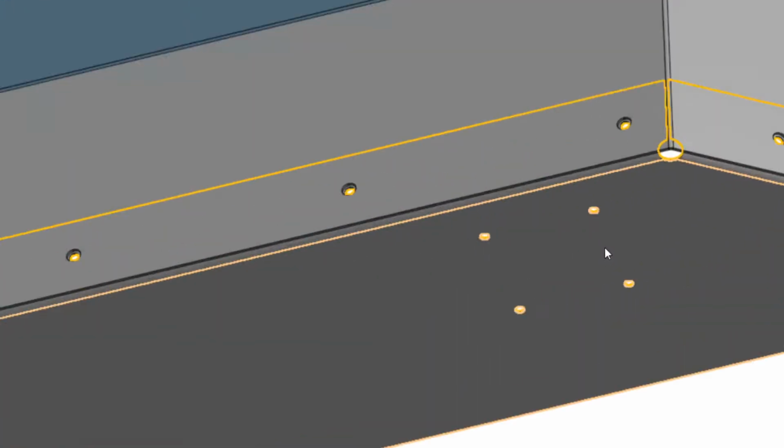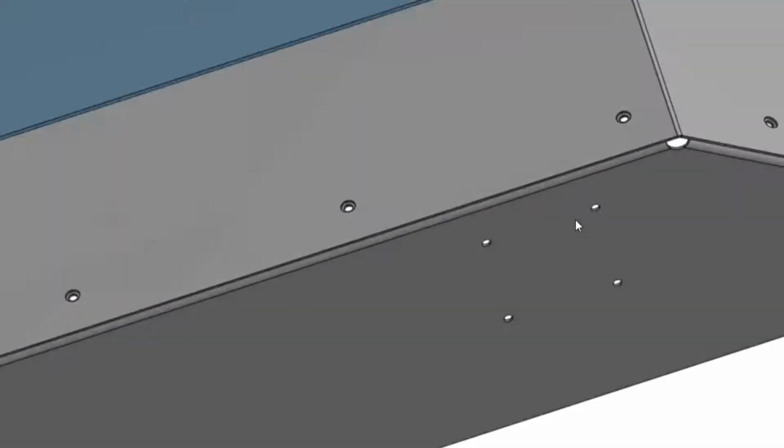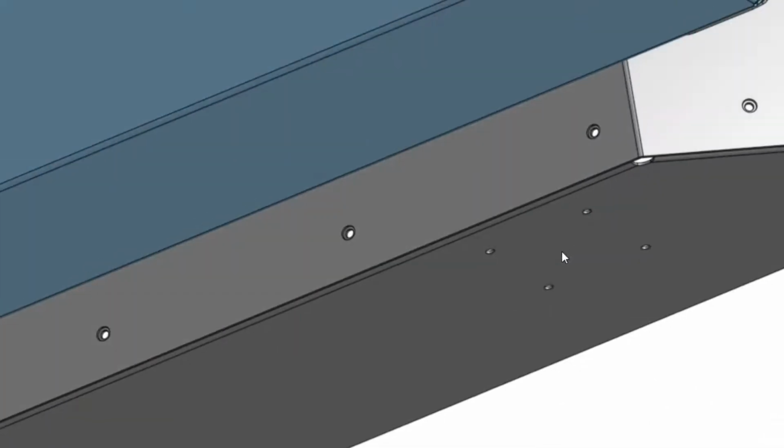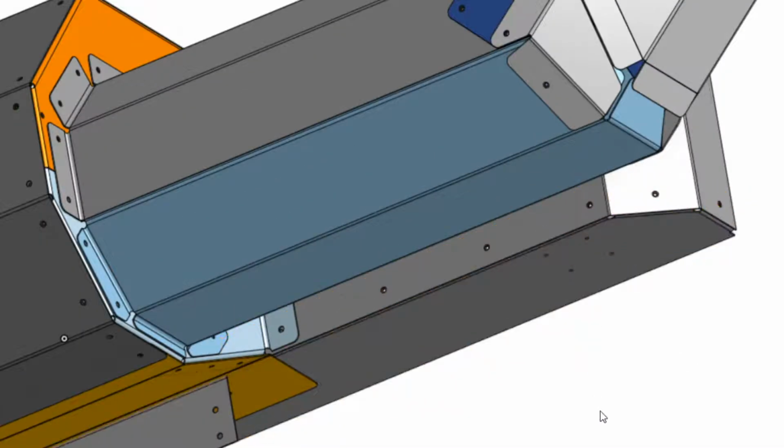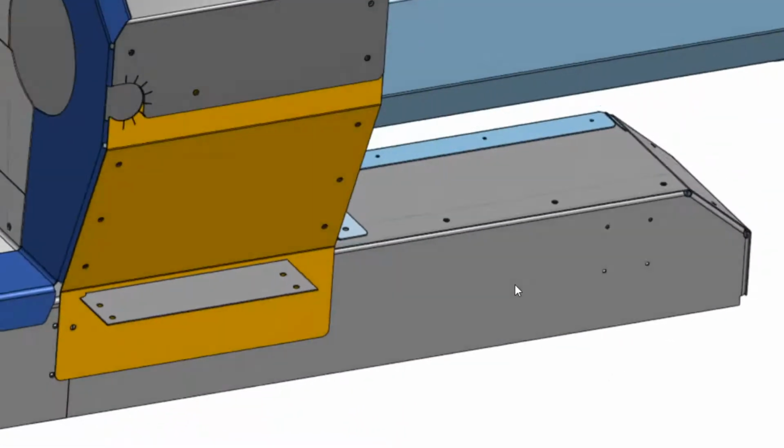Similarly, the four holes over here on the right are the holes for attaching another bracket piece, a tin bracket piece that's shown in the tin assembly, that extends down here a little farther, but also has a slotted hole that will overlap an open tapped hole in the block, and so it's a way to assemble the bottom part of the tin to the engine block itself.